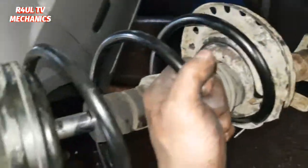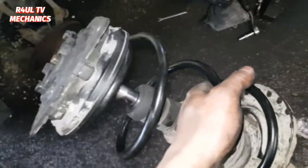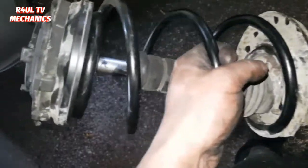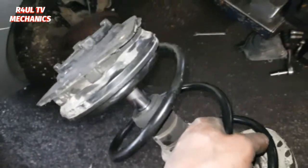The new spring is totally on and ready to go. Like I mentioned, you need a proper spring compressor for this — don't try it with the individual clamps or you'll be struggling. Now I'm going to refit everything in reverse order. Let's finish it off.